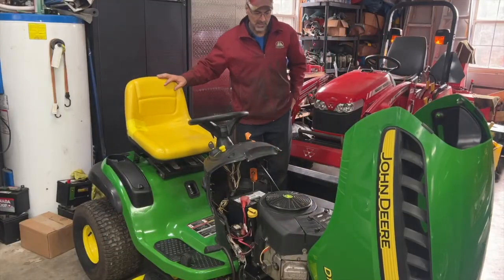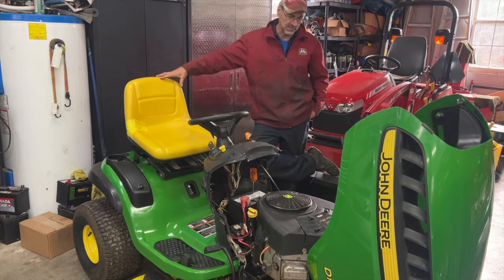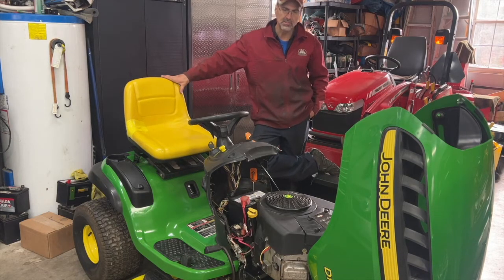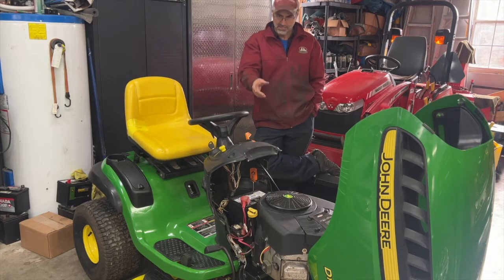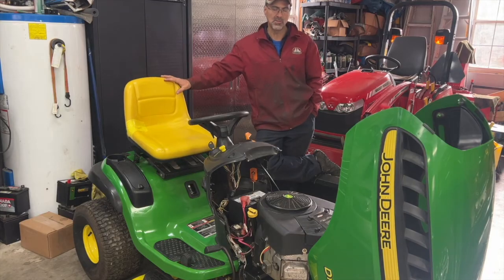Here I got it all back together. Things that weren't in the video: I did check the valves on the right-hand side cylinder and they were okay, and I did the compression check — that was good too. Another thing I did is unplug the kill wire on each coil, but it didn't make any difference, so I plugged them back on. They have diodes in there and if one could be flaky it could cause misfire, but it was okay. Anyway, if you like this video press thumbs up below, subscribe to my channel, thank you for watching.